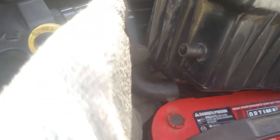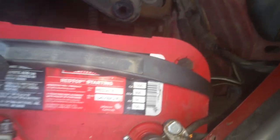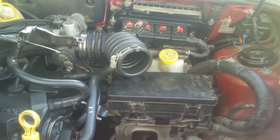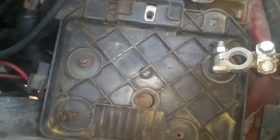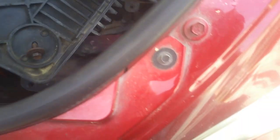I'm just removing the air box — got a vacuum hose here and that air duct connector. I'll just lift this whole entire thing out of here. Going to go ahead and disconnect our negative and then positive and get this battery entirely out of here — it's going to be getting in our way. We've got this tray down here with some 10 millimeters — just take those all loose and get this up out of the way.